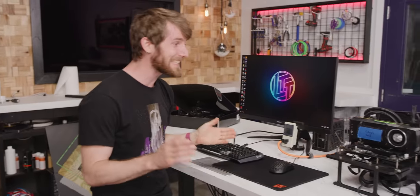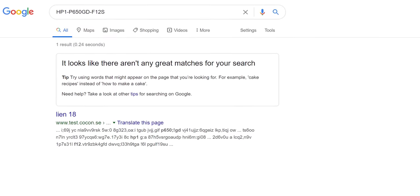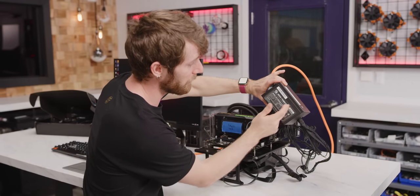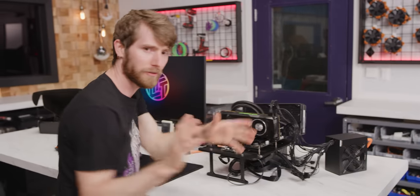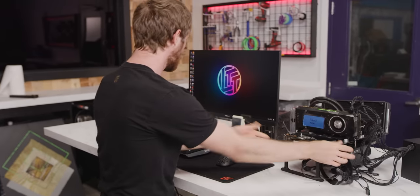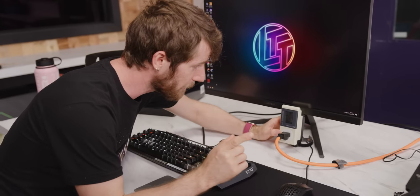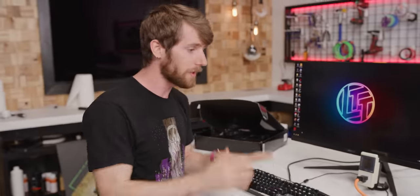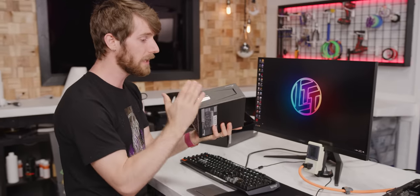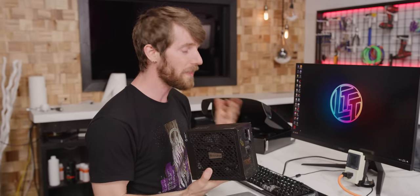You know what the crazy part of this is? I was just guessing at what kind of grade of efficiency power supply this was. If you Google this part number, literally zero results come up. So I was guessing 'GD' was going to mean they were targeting around 80 Plus Gold-ish efficiency — that's why we picked an 80 Plus Gold Seasonic Focus Gold to compare it to. And even though we've got a graphics card and everything, we just cut our idle power consumption literally in half — less than half. What about rendering? These changes are really focused on idle power consumption, and once you reach the wheelhouse of a conventional power supply — typically around 50% load — the advantages pretty much disappear. That's why I didn't do a heavy load test before and after; I'm not expecting really any savings there.